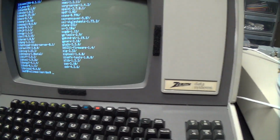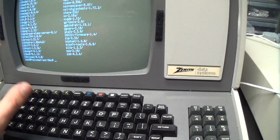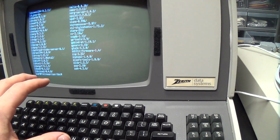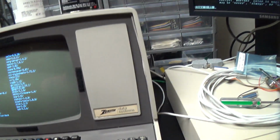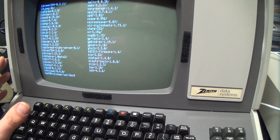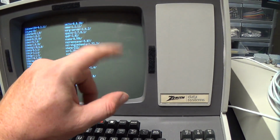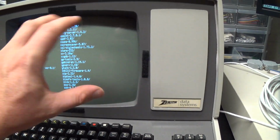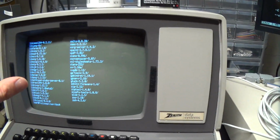And I've got this plan to try to use some analog switch ICs to make some kind of crossbar serial switch thing, and then I'll plug all of my serial hardware into this serial switch box, and then on the box, using some buttons, I'll be able to talk to a microcontroller to make it close these switches in a crossbar fashion to connect any serial equipment that I have up to any other serial equipment that I have.